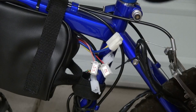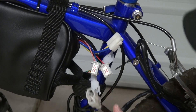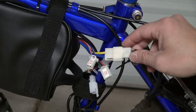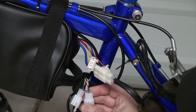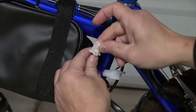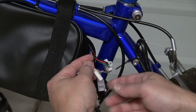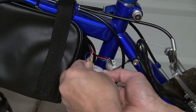Let's make the connection. This wire comes from the electric motor — it goes through the blue and yellow to the controller. Snap — like that. Now for the throttle: these two wires go to the throttle, which is green, black, and red. There's also a switch to the throttle that is blue and yellow. Here's the throttle part — it says input — and you connect them like so. The switch to the ignition says power lock.